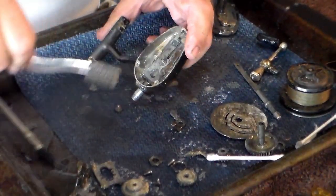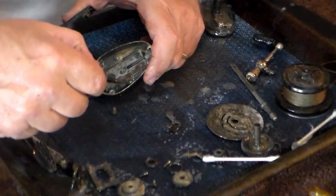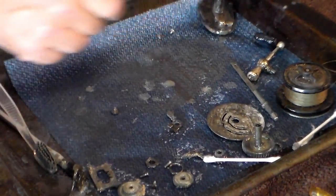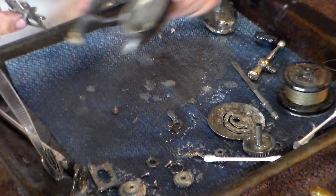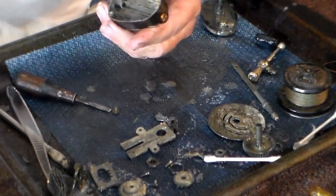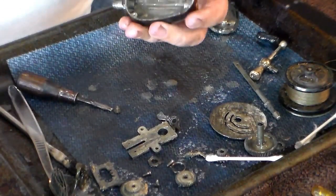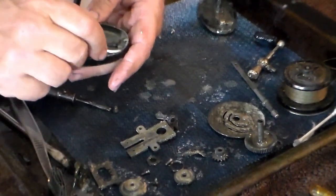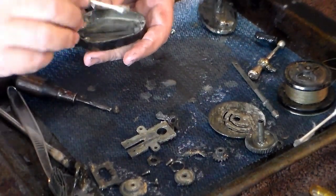We've got this down and cleaned to the point where we can at least now see these two screws in here. We're going to remove those. With those removed, the oscillating base plate can come off, and we can finish scrubbing inside the housing. You can only go so far cleaning with a rag and you can't get up in all these nooks and crannies - for that, a cotton swab works beautifully.